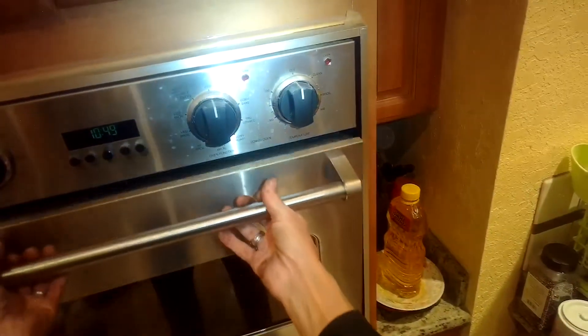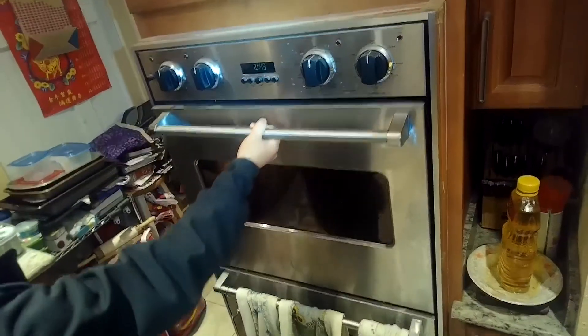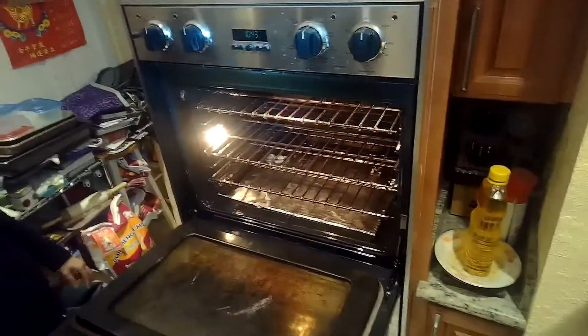You should feel like there's way more spring tension now that's going to hold the door shut, because the springs are fresh and they have a lot more pulling power. So no more heat will escape, the light will not go on, and it'll heat just like it's supposed to. You'll probably get maybe another 10 or 15 years out of that.